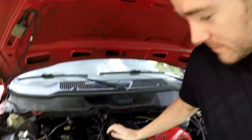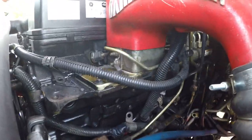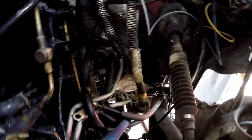We went ahead and rebuilt it, so I basically have a new motor now — and a new turbo, new everything. The 170,000-mile truck is now back at zero. It drives great. We cleaned up a lot of stuff under here, painted the head and the block so it's not rusty anymore. It's still kind of dirty and the wiring's crazy, but the block looks a lot better. Got a fuel filter delete too — I got rid of the huge bowl. I still have the stock fuel line here that I need to do something about.